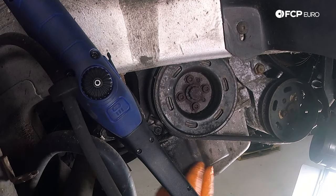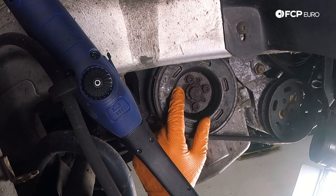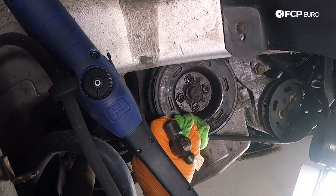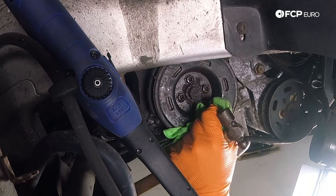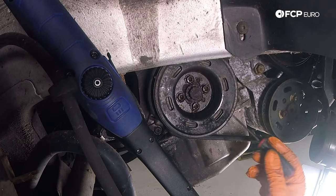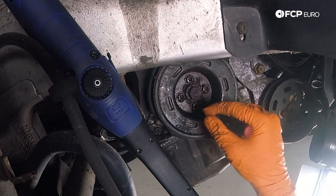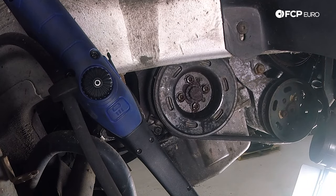You can use a pry bar to gently persuade the hose and the pipe out of the hose itself, and just work it down and off the intercooler and the other pipe. Now we have the charge pipe removed and access to the crankshaft pulley, but the pulley bolts that hold it down are completely rusted over. We're going to spray it with some penetrant oil. What you don't want to do is strip these out, so spray these a few times, let them sit, get them nice and lubed up. Get a pick or a screwdriver and try to remove as much rust from the inside as possible. If there's any rust forming that prevents the 6mm Allen socket from sitting all the way in, that will lead you to strip it out. Just get in there and try to loosen everything up as much as possible.